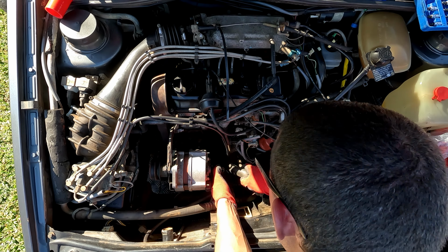After a bit of fighting, the one that actually failed, where it split right there, is back out. I forgot how annoying these are. This seems like an ABA where the water pump's at the bottom. This one coolant hose goes from here down to there, and there are actually two more below it. They're quite a pain to get to, but we got this one out. This is what it will be replaced with. That'll go from the top neck down to the bottom, and we have this little tiny one that's gonna go there and lower below that, which will be fun to get to.